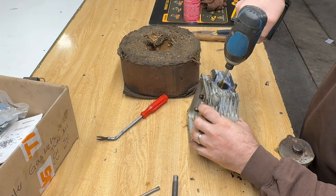I'm still a little suspicious of the coil setup, but we did have pretty bad spark plugs, so maybe that's all it was. It was dropping this cylinder because of that head gasket and that very fouled up spark plug. Carburetor, the accelerator pump might not be working. I do have the kit on order to rebuild that accelerator pump. What else here?